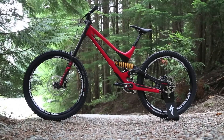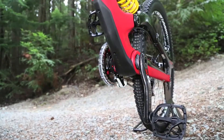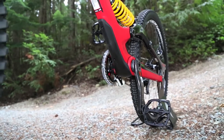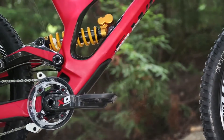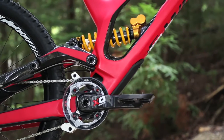To keep it turning so well and changing direction so well, we wanted to lower the center of gravity more. You can see the suspension layout's been revised — Jason Chamberlain put all the pivot points down lower. In that same process, we changed the FSR around a little bit. Gwen and the racers asked for a little more bottom-out control at the end of the stroke, to help control the big hits after the big landings.